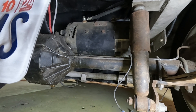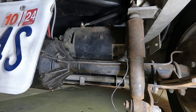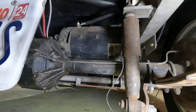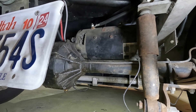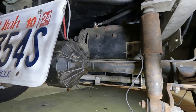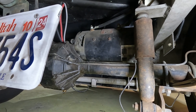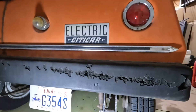Here's the heart of the matter: a 36-volt GE series wound motor that plugs right into the transaxle. We throw 48 volts to it, so we over-speed it a little bit to get our whopping 35 miles an hour out of this thing. This particular transaxle is not really upgradable — it's not great as far as being able to throw on bigger or better motors. Some of the later models do have a different transaxle that can take upgraded motors, and some people put, like, 96-volt motors in this thing with brushless setups and all kinds of space-age stuff.